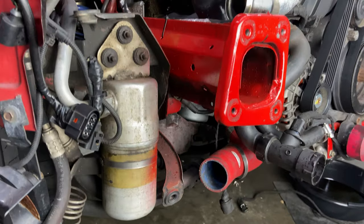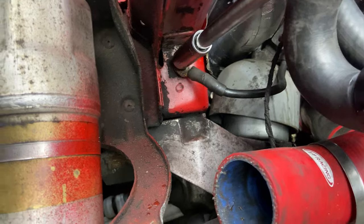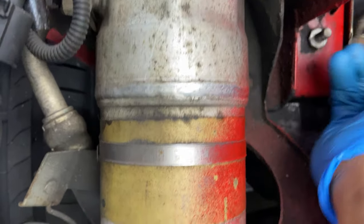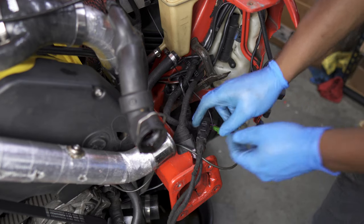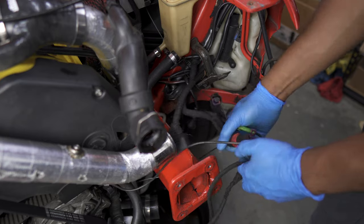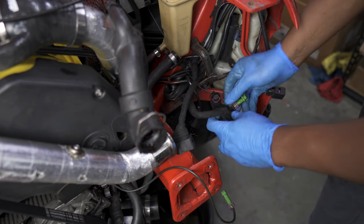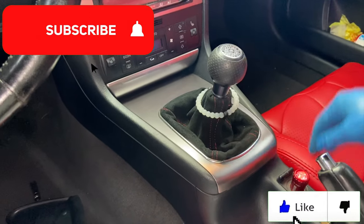The second ground is under the frame on the passenger side—that's a 13mm. Go in there and release that, then put it back on. The last thing here is just a few connectors that we have to go ahead and unplug. Usually there's a little plastic bracket holding them all together. All those connectors have to be undone at this point.